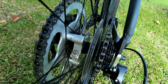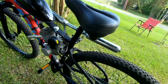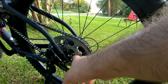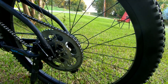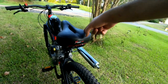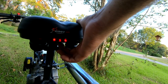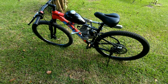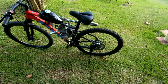It doesn't appear to be slipping so far — we won't really know until we're out on the trail. I've been using the pull start to start it to avoid any forward slipping. For the 56-tooth sprocket, the only modification we had to make was opening up the mouth — my friend did that on his lathe. If you have hole saws, you might be able to do it yourself, but it's hardened steel and it took a long time. This is an aftermarket seat from Amazon with good reviews — it feels pretty comfy and has a built-in light, which is garbage, but that's not why I got it. So this is what we got so far on the 2021 Swintaf — I think this is going to be an amazing motorized bike for the price.